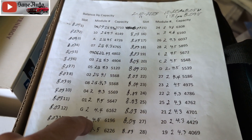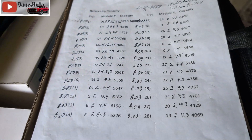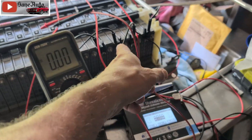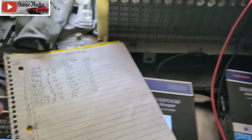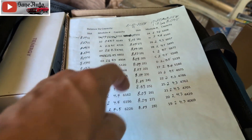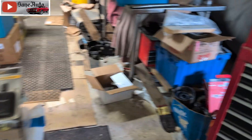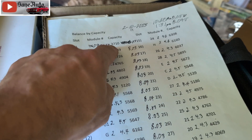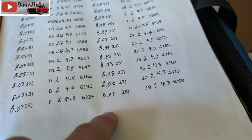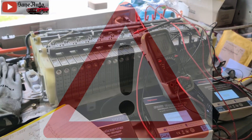The best ones in that pack were over 6000 mAh, and that pack lasted over 90,000 miles. The modules I have here that started out at less than one volt — after one cycle I'm getting way higher capacity readings than that pack had 90,000 miles ago. And all of these in this box that I will not use are less capacity than that, but look at the voltages: 8, 8, 8, 8, 8, 8 — they all show over eight volts, but they're no good.